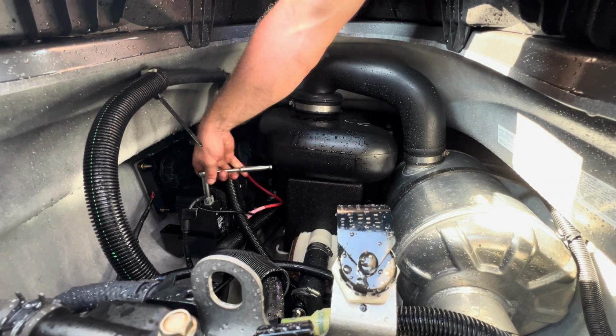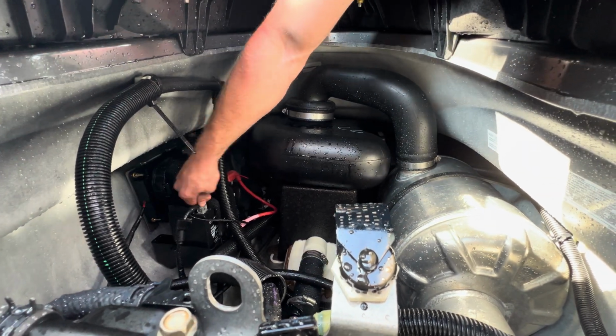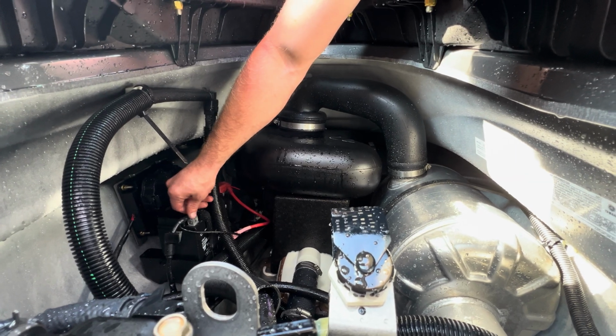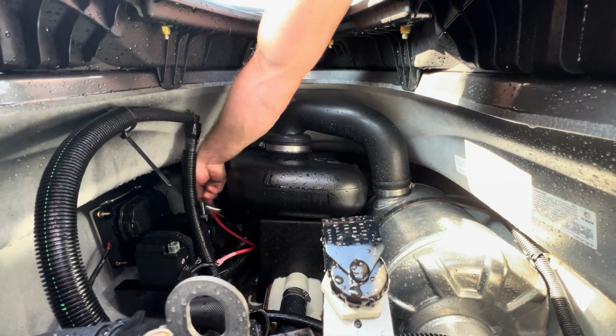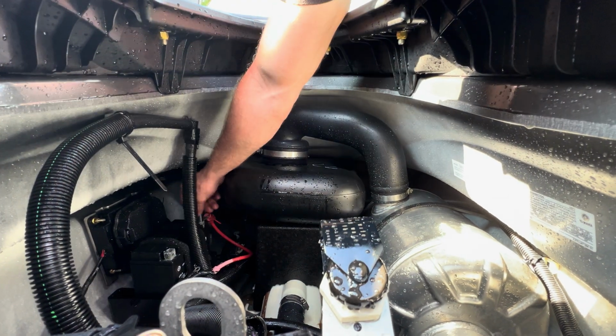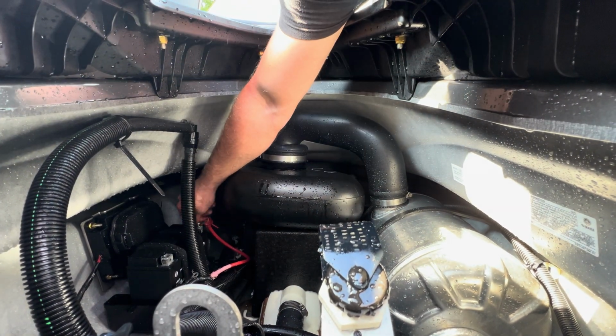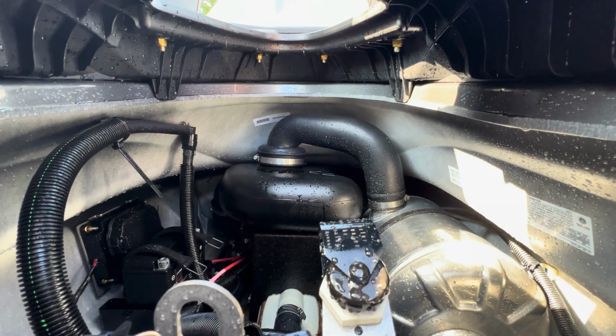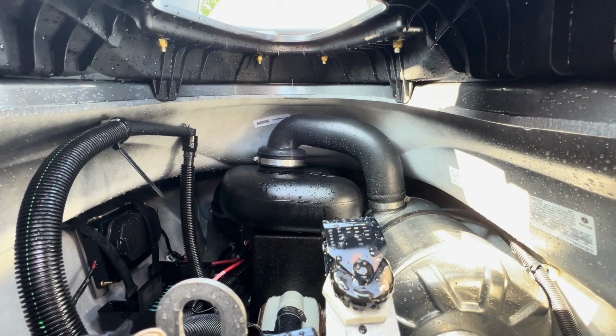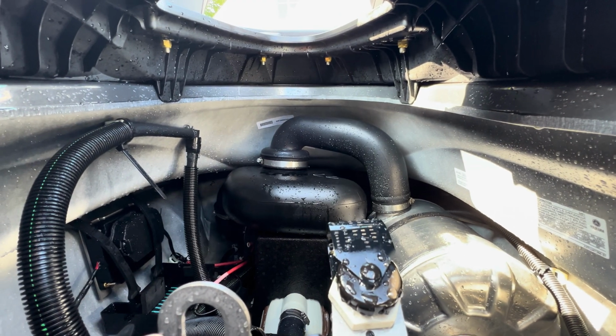Changing the battery is a little difficult because it's a tight fit where it goes, but the process is pretty easy. First, disconnect the negative battery lead, and then disconnect the positive. Next, unhook the battery tie-down bands and take out the old battery. This is a good time to check the bands for any damage and replace them if there is.